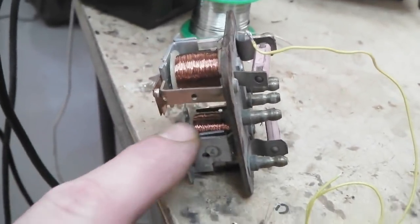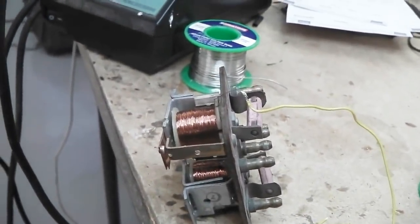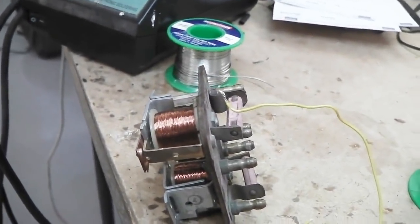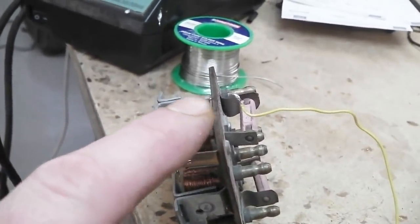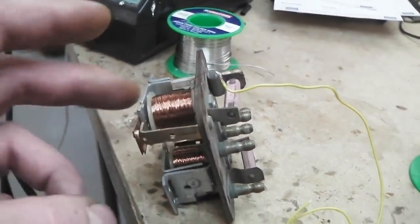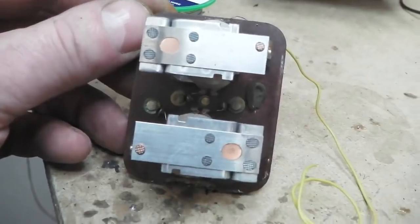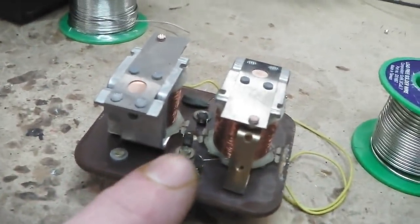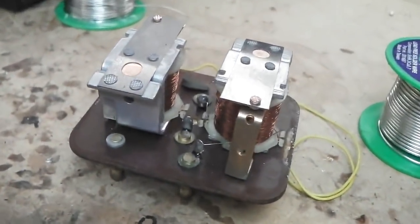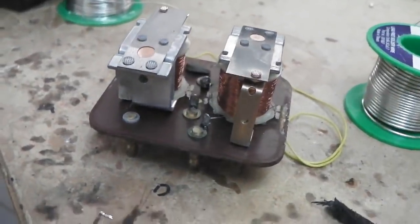However, the high beam works, but the dip beam was not on. At first I thought it was a switch, but I jump leaded out the switch and put power straight to the relay, and the relay wasn't activating. Then that's when I noticed its wire had snapped. The strange thing is there's no sign of the broken wire inside. There's these little posts inside, and it's soldered to those, but I can't see the wire broken off the post.